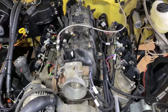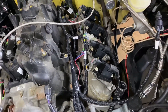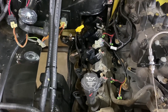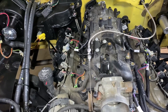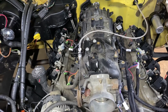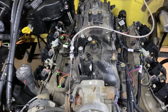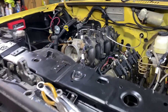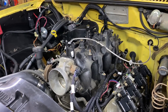Okay, back here at the motor. Thermostat is now done. We got all the coil packs replaced. Plug wires are back on. Plugs are all back in, obviously. These were not the original coils — these were some other aftermarket coils that had been changed once before for sure. Now it's got original AC Delcos in it. Okay, so I got the fuel injectors in the rail, so I'm going to bring it over here, slap it on, and then we'll test it for fuel leaks.